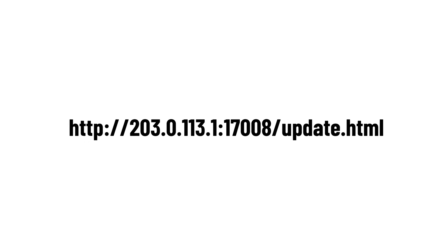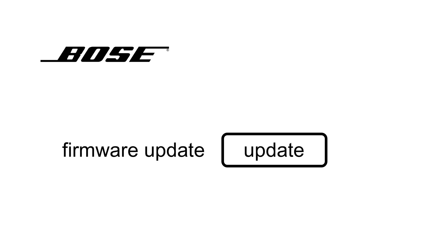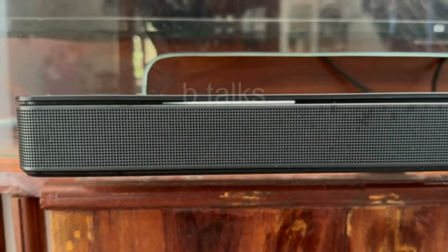Open a browser from your computer and open the following address — you will get this link in the description. If the link does not open, try entering service mode again by pressing the remote keys, or reboot again. Once the link opens, the page will ask you to locate the firmware zip file and then update. The white light will again move left to right — leave it like that. Your system will upgrade and restart soon.